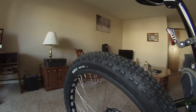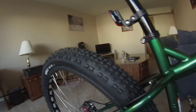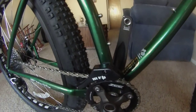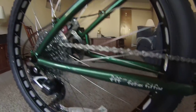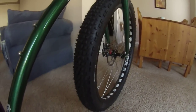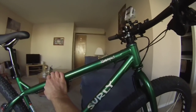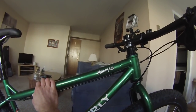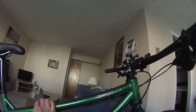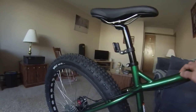I could run a triple in the front if I ran standard 30 millimeter 29-inch rims and a regular two-inch tire, but I think this setup will be pretty good. I don't think I'll really miss the triple — the single should work well with the 10-speed in the back. It says 'Fatties Fit Fine' and they do fit damn fine. These are three-inch Nard tires, and it'll be a lot better for the dry single track riding I do — faster and more responsive on the turns. I look forward to getting it out there.